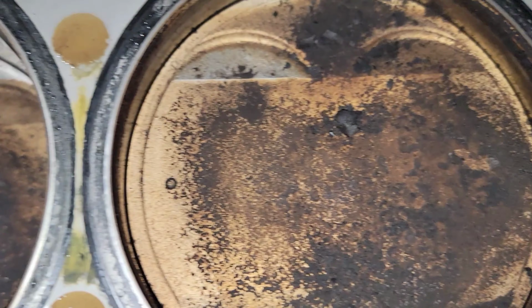Alright, after fighting with this, I'm thinking there might be some bolts that go up through the bottom and go into this. There might not, but I'm not going to risk it and sit here and try to pry on it and break stuff. So, we're going to go ahead, flip this over. Actually, let me see if I can drain oil out of it first. Then we're going to flip it over and take the lower pan off and see if there's some bolts going up through.